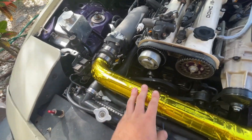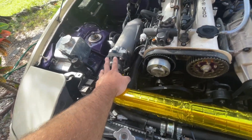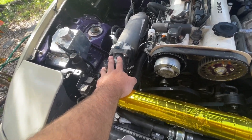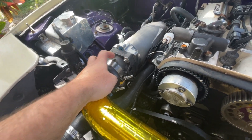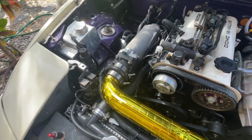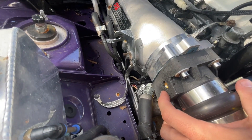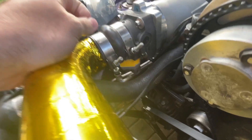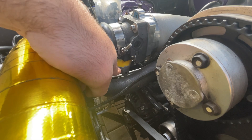This kit is usually meant to be used with a dummy throttle body here. The only dummy throttle body I have is for an NA8, and since I'm using the VVT setup and I want to keep the ICV from the VVT engine, I'm using a VVT throttle body here that I fully gutted. I welded all the holes shut, then tapped the holes where the old mechanisms were. You can see the welds that I painted over.